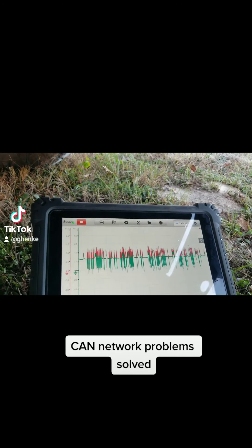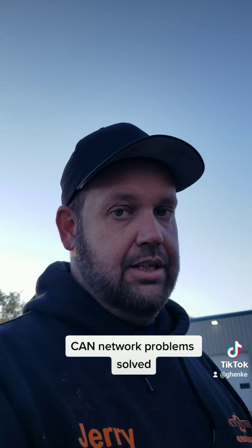On the wiring diagram, this is the data link resistor I have in my hand that we tested. This is a 6.6 Duramax. Follow the wiring up — it's going to come to here where it says 'with or without trailer brake.' This is with trailer brake, so it goes back down to the trailer brake control module and then back out. This CAN network is going down because it cannot communicate through this module.